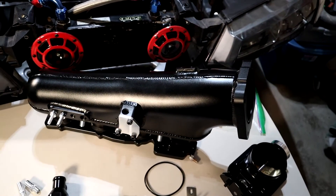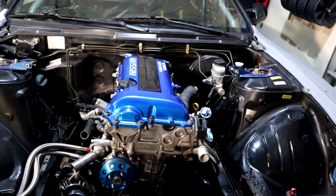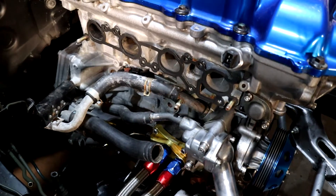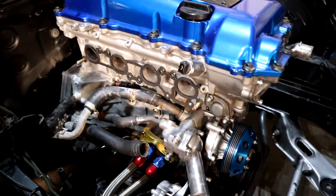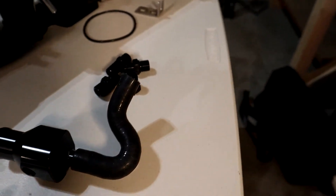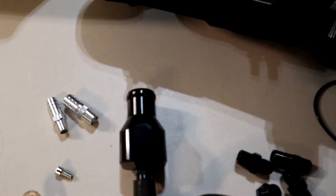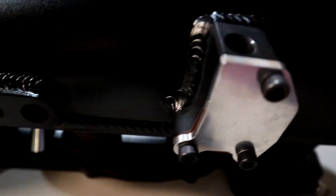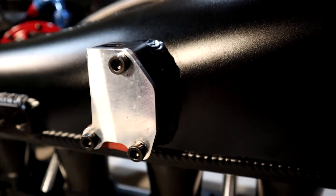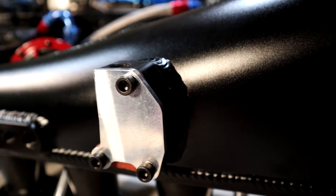I hope this review helps you understand how to install it onto the stock SR20 and possibly retain those hoses. For most of you, you probably don't want to eliminate all the hoses like I'm doing. So use the collector, maybe shorten that large hose, and it should fit pretty well. You might need to get creative with these nipples that go underneath because there's going to be a little bit of a clash there. I haven't tried to actually install the idle air control valve underneath, but when I look, it seems like there should be enough space for it.